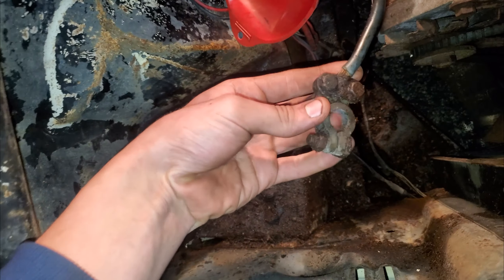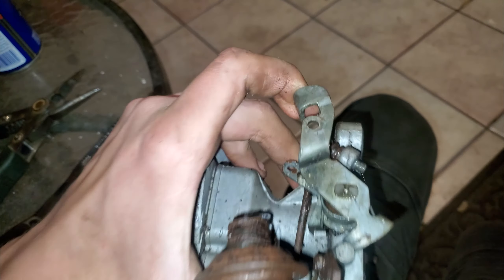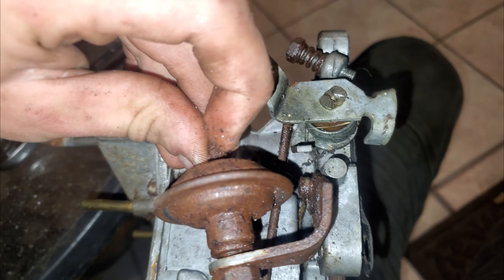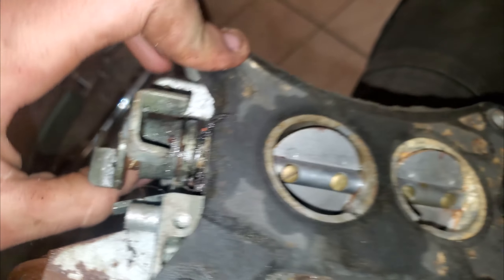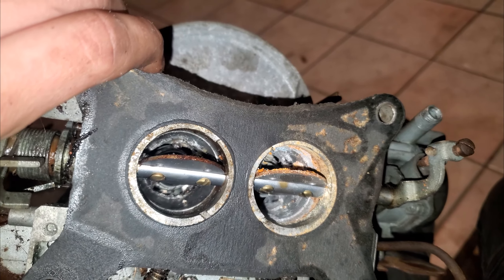All my wiring on this car is looking good — none of it really looks like it's been messed with a bunch. So hopefully it'll plug up and go. I'm going to clean off these contacts anyway. With a lot of prying, I got the carburetor top open. It needs to be lubed up like crazy and that spring is about to break. When it comes to cleaning carburetors and anything that requires finesse, I like to sit down and do it where I can relax and take my time. You can see it's not so pretty in there, but a lot of it's just gunk from around the air filter that's made its way down. With a good carb clean this thing will be fine.